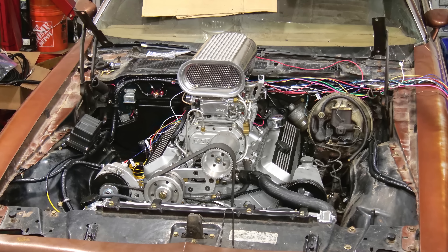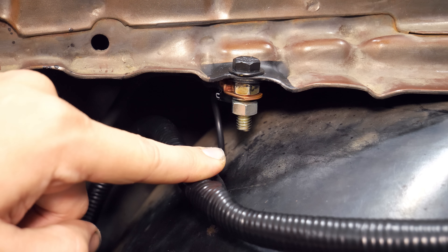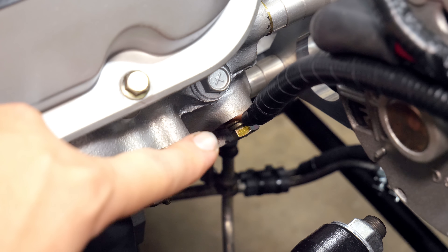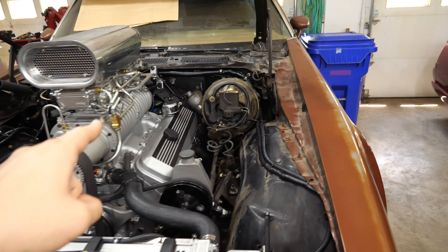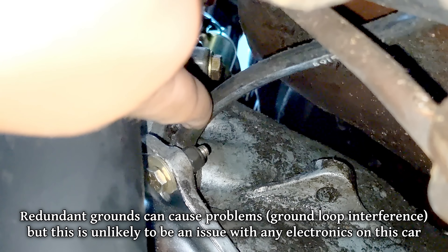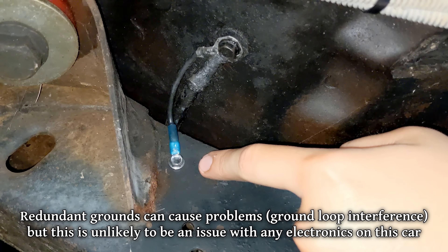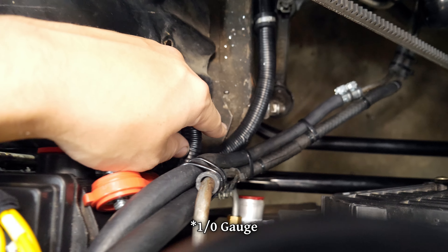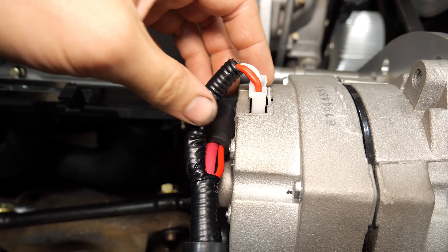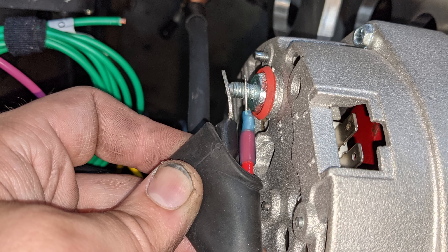Since we sped through all that work with the time lapse, I want to give a general overview of what's happening. The negative battery cable comes up and grounds to the fender right here — that's a six gauge wire. The bigger four gauge wire comes up and across right by the alternator down to the cylinder head. We've also got an engine-to-body ground going from that stud we installed in the firewall down to the rear of the cylinder head. There's also a ground wire between the transmission bell housing and the body, and I added another little jumper down to the frame to make sure the frame is also grounded. On the positive side of the battery, we have the one gauge coming down that's routed back to the starter. The six gauge wire comes up here to the alternator.